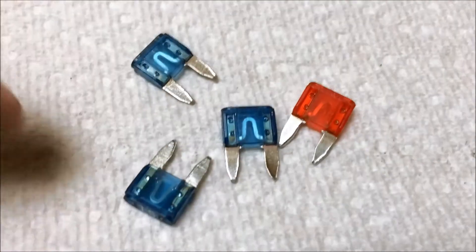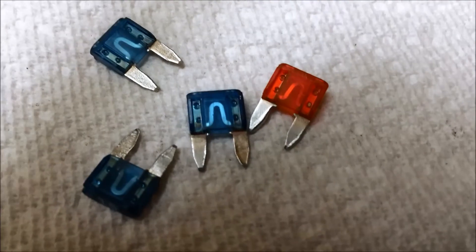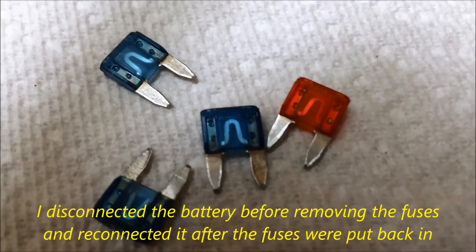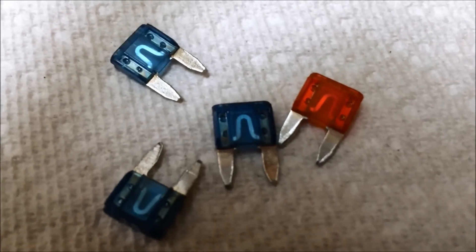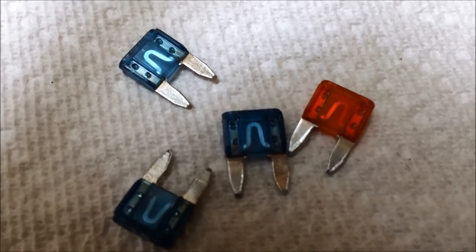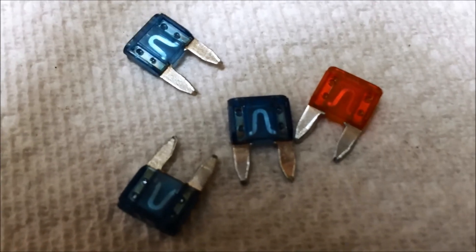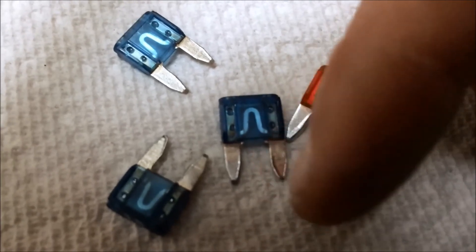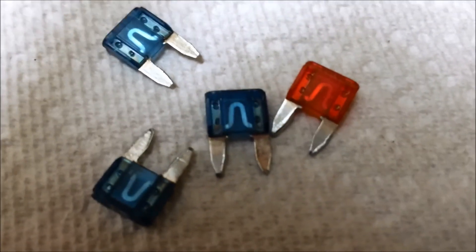What I discovered today is that I went through every fuse in my car. Every one of them had oxidized and had an improper or unclean connection. I cleaned them all, disconnected the battery, put the fuses back in, and it has cleared all my check engine signals — the check engine light has not come back on. So if you're having electrical issues in your car, go through these fuses, clean the oxidization, and inspect for too much wiggle room in the legs. If they're too loose, put a new one in and see if that corrects your problem. Hope it works for you.